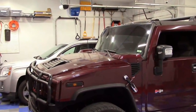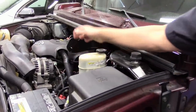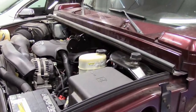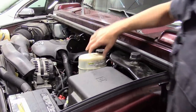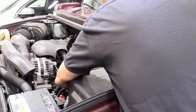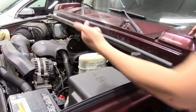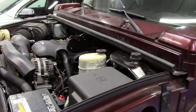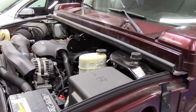Some of you guys are wondering what is a Hydro Boost. A Hydro Boost system is kind of a fancy addition with the power steering to give further assistance during braking, especially on a large vehicle like this. What happens is you get a leak with the power steering fluid, and you keep having to add power steering fluid. But the leak is actually up here — you run your finger under the power brake unit and you can see fresh power steering fluid. The power steering hoses actually connect up behind the brake reservoir, and that is what is leaking.